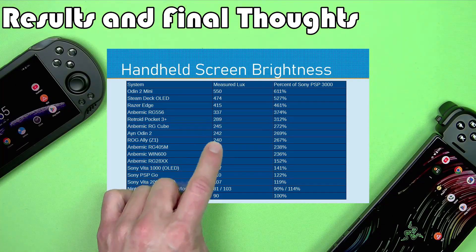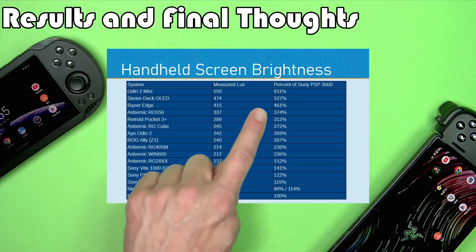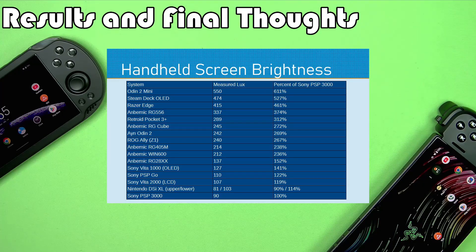You can see there are kind of the middle-of-the-road handhelds, and then the upper echelon of brightness, which are mostly OLED screens, and then the Odin 2 Mini with its mini LED screen. They're all way brighter than the PlayStation Portable. The PSP had three brightness settings, and Sony restricted the brightness when on battery to claim higher battery life — you could not use the brightest setting on battery. One of the things custom firmware did was unlock the highest brightness setting on battery, and I remember that being almost as good as any other aspect of custom firmware back in the day.